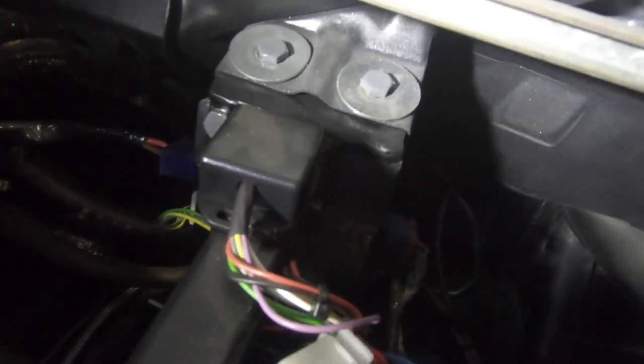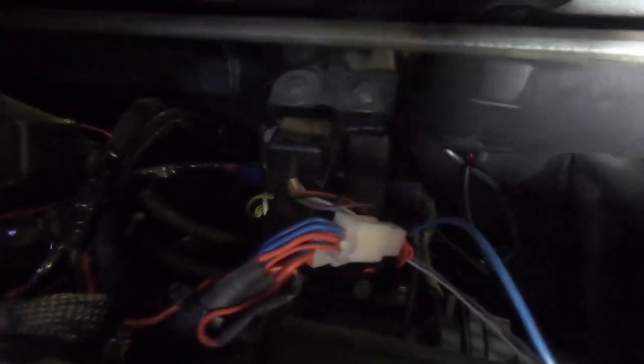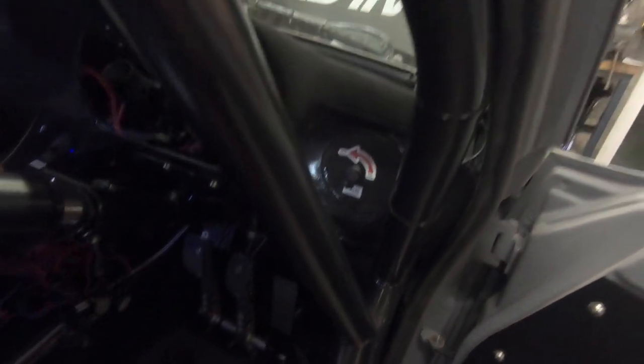The Rick's Engineering controller comes pre-wired with a white plug — yellow and green wires — with an adjuster so you can dial in the level of assistance. The controller also needs an ignition live and earth on light-gauge cables. That's pretty straightforward to wire in — I just zip-tied the controller onto my bracket. I'll put the steering wheel back on and then we'll turn it on and show how the assistance range works.